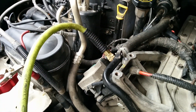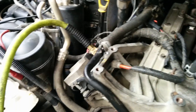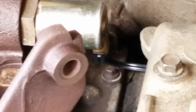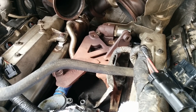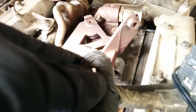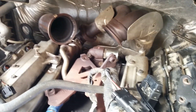I have an airline attached to the high-pressure oil system through the ICP fitting on the 6-liter. I have a pigtail attached to the IPR — it's the pigtail from the IPR actuator, tons of them on eBay. There it is down there. You can hear the air discharging; you can see it coming through the turbo drain back fitting to the top of the high-pressure reservoir.